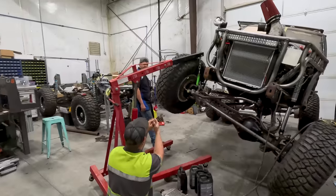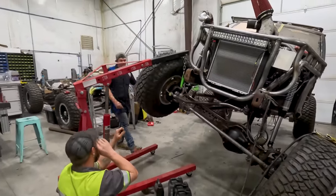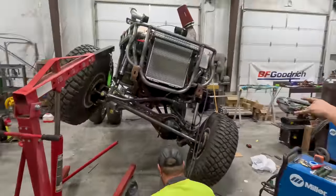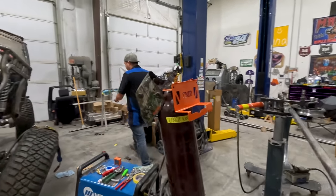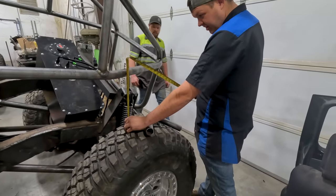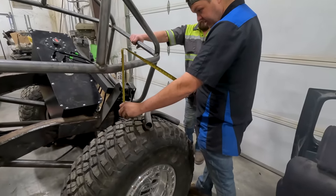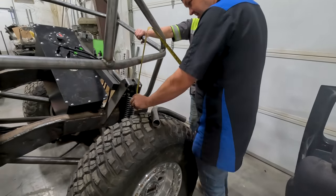What the heck? Looks like it flexes more than it did last time. What are you doing? So, I need to figure out the rear tube work. I need to see where I can put bars. So we need to flex it out. Bars for what? For this rear. So basically, as long as I don't have a bar any lower than 12 inches, so I'm probably gonna go to 10. So if I just match this bar to 10 inches, I think we'll be okay.